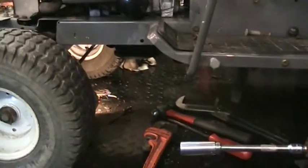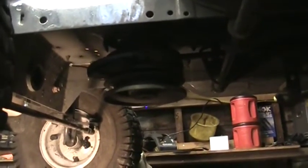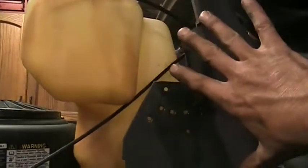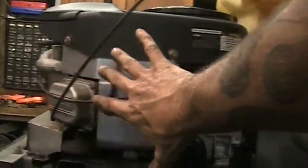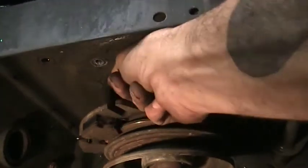Okay, I cheated — well, it's not cheating, it's the flat-rate way. I couldn't get the crank pulley off the bottom of the engine — it just wouldn't come off for me. So what I did was unbolted the exhaust on either side, got the brace out from behind the gas tank so the gas tank could move backwards, and shifted the entire engine backwards in the chassis. That got enough of a gap that the belt slides out from underneath the guides, but it didn't have enough slack to pull the belt all the way over the pulleys.